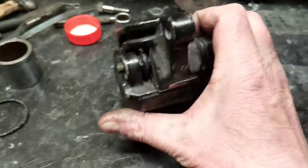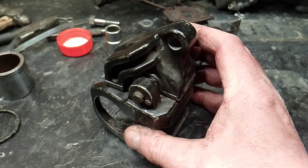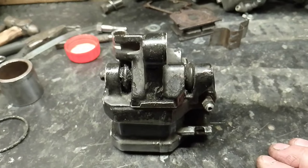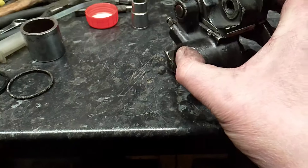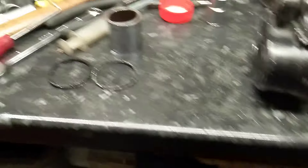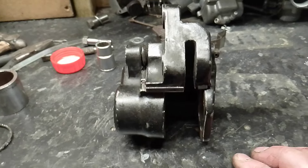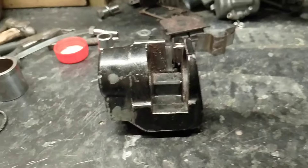It's very very tough. I've already had it in the vice — I had a socket one side and the vice the other side and tried to push it — it wouldn't have it. I thought okay, I'm gonna have to get some heat on it, but before I do that I wanted to work out what rubber I can save, and hopefully I won't destroy these ones either side. Not been to bits for a long while — you get a combination where the piston ain't going back very well and this bit's seized, you're not getting free movement. When you let go of the lever it still binds, so that's the problem. I'll keep you posted — I'm on the brakes. Thanks for watching.